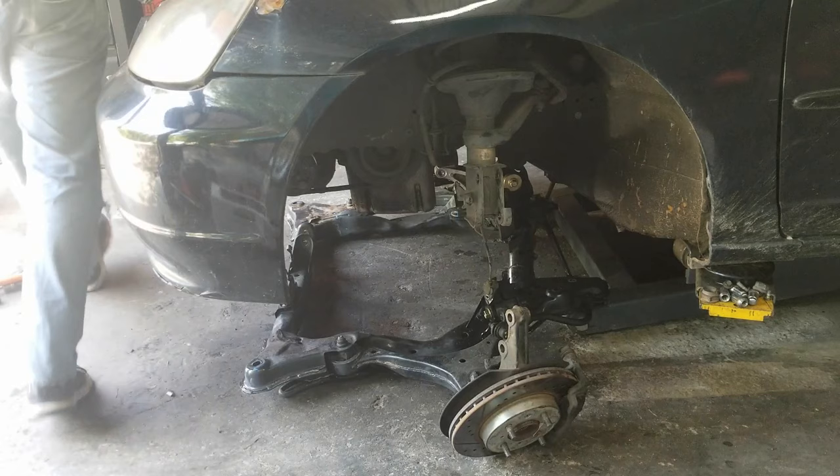We'll have to remove the starter wiring — that's 12 under here — and then this one just pulls off. I don't recommend taking the starter off until the transmission is already out. You can do it — it's two 14s, one on top one on the bottom — but I just disconnect the wires off of it and call it good. We've got our counter shaft speed sensor, our range selector, our actual speed sensor, and other wires off the little brackets. Now all we've got left is the torque converter switch — it's kind of tricky to get to. So we've got all the wires off the transmission now — just leave them up here so they don't get smashed.